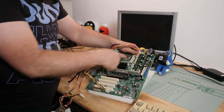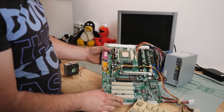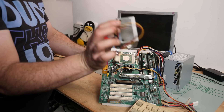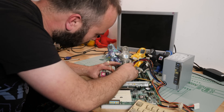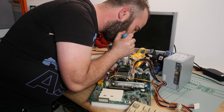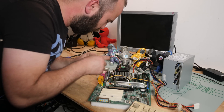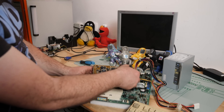This power supply also has an aux connector but I'm not going to use it. There are two styles of CPU coolers you can install: the later style that uses the big holes but bends the motherboard due to too much pressure, or the old school style with clips — with the danger of damaging the motherboard with your screwdriver. You put the clips around the notches on the socket, push the clip down on a flat surface, and bend it around the notch. Then connect the cable to the CPU fan header.